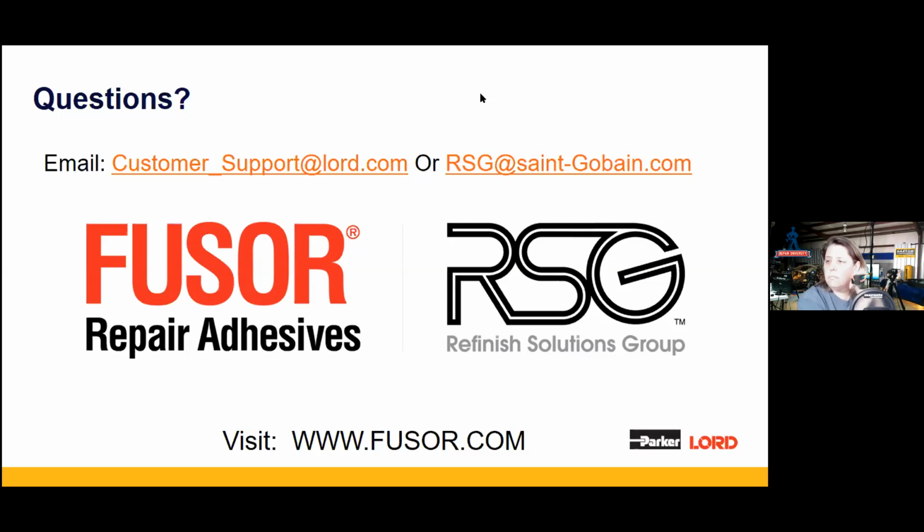Yeah. So if there's nothing between the panels and the manufacturer has no guidelines, a one component seam sealer is not going to add any rigidity or change to the overall vehicle structure. What you're doing is putting something between there that effectively seals out that whole area from any potential moisture intrusion or salt intrusion. So it's fine.